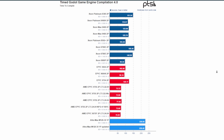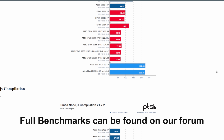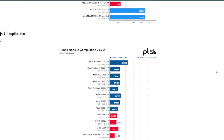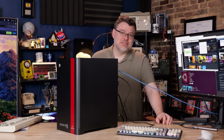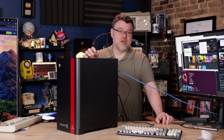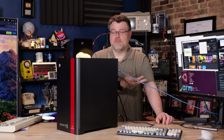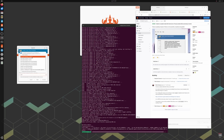Whereas this platform, because it's PCI Express, you can do what you want. Do you want to run an AMD GPU in this? Yes, you can. Do you want to run an NVIDIA GPU in this? Yes, you can. And I get why they shipped this machine with a 4060 Ti. It's because NVIDIA has done a lot of work to be up and running on the ARM platform, including downloadable Windows drivers for the 4060 Ti and other modern NVIDIA graphics cards, which is actually pretty exciting.